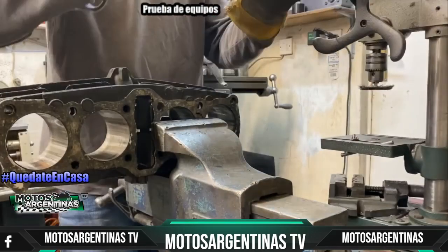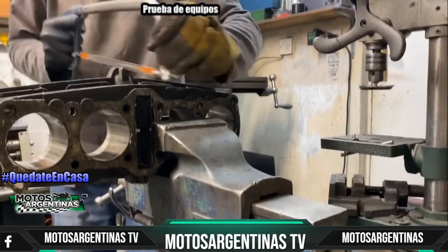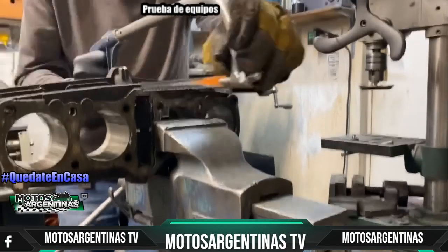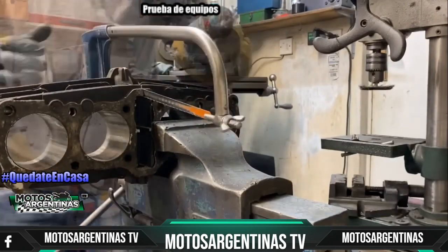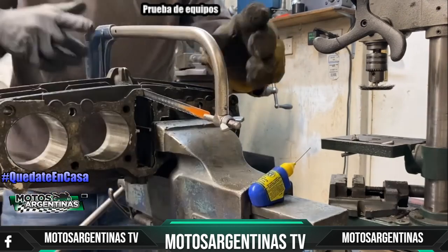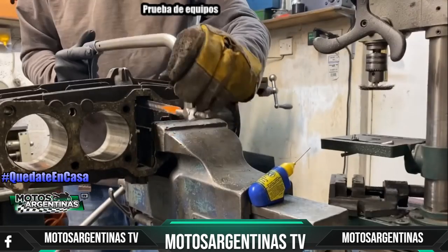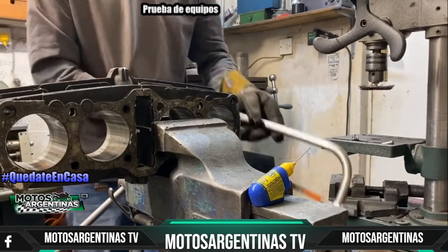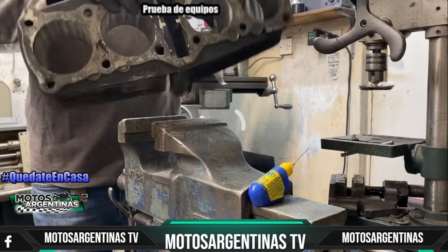With all the liners out, both barrels, I proceed to do the cutting through the first set through the cam chain tunnel. Sometimes the castings are a little bit hard, due to silicon probably in the aluminium, so I add a bit of ZX1 oil. It makes a huge difference. With the first side of the cam tunnel cut, I reverse the barrels in the vise to cut the opposite side.